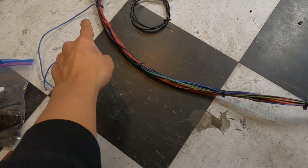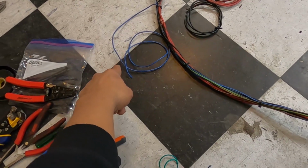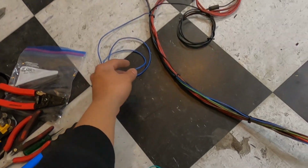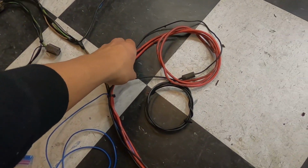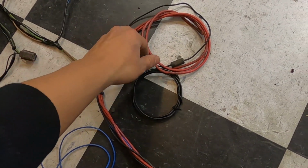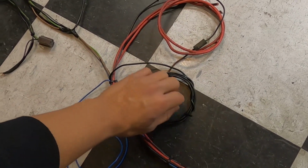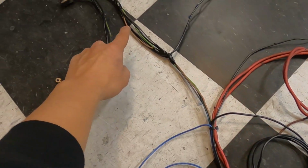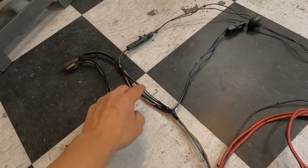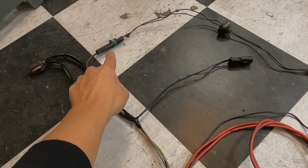And like I said, we come in, continue here, and this is pretty much the radiator support at this point. And that's that trinary switch that's going to run back to the switch that'll be on the dryer. And then we have our battery cables that will land here, whether they're on a post or directly to the battery, I'm not sure yet. So we just kind of coil them up in here. We got positives, and this is their ground. And then obviously we continue here to our headlights. We got low beam, high beam, and then you're going to have the rest of your lighting, just your turn signal, and that's your side marker.